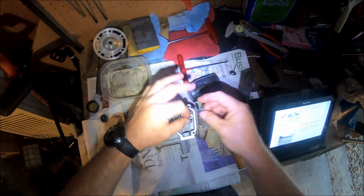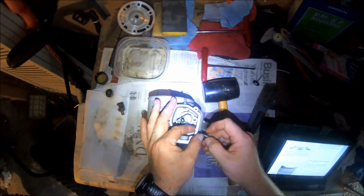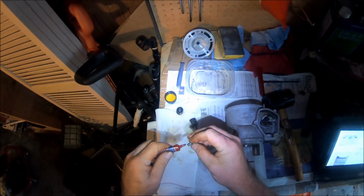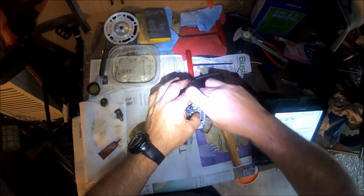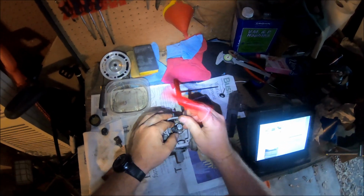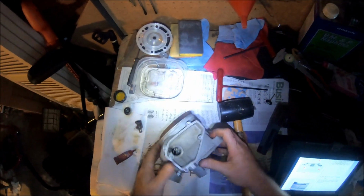Oh, let's try that again. Get this guy. And since you're in oil, I've got my Loctite 243, which is an oil-based Loctite for use in oil inside the heat of an engine, which I learned about when I rebuilt my KTM motor. I had to do the whole thing on that. Tons of fun. That's a different project. So you get that down in there. Just kind of snug it down for now. Might have to take it off.